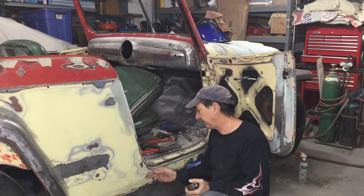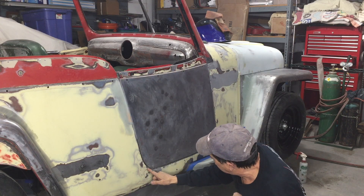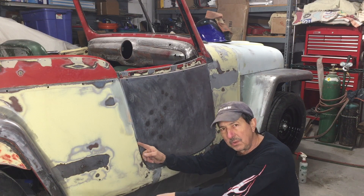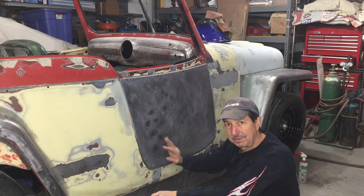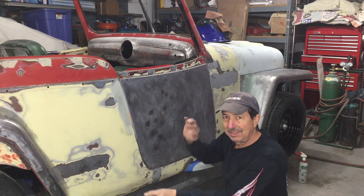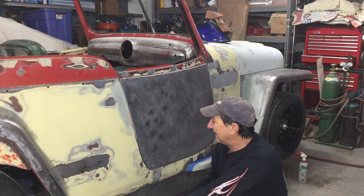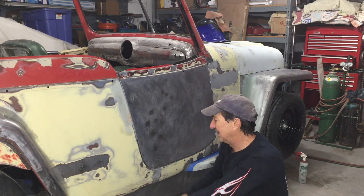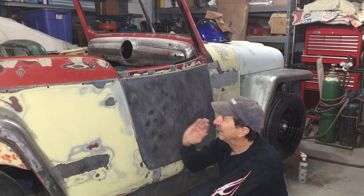It's starting to bulge out a little bit more than I want, so I'll use my shoe to hold that tight and then tap back — just a hair more right here. What I'm after is about a 3/16th of an inch gap. Some guys do a quarter inch, then after all the paint and primer it closes to about 3/16ths. I like to go 3/16ths and close it up to an eighth. An eighth inch is kind of tight for a topless car — you run the risk of chipping the edges. I had a '69 Camaro convertible chip the edge on a hoist. But an eighth inch gap just looks so nice, especially on a coupe. This one's got a really good frame so I'm going to go tight.